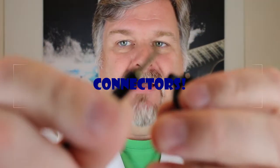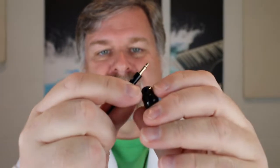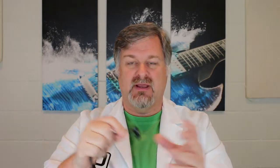The other big change: connectors. As you can see, this is a 2.5mm connector, and this is our little 2.5mm plug. We now have detachable cables — a standard 2.5mm connection. Why 2.5mm? The TS/TRS coaxial format has been around for 100-plus years, because they work, they don't break, and they last forever. There's no orientation issue — you just plug it in. You've seen 3.5mm that everyone uses, the 6.35mm quarter-inch phone jack — all standard connections. A lot of high-end brands like Sennheiser and AKG have used 2.5mm jacks on headphones because they're easy and reliable.